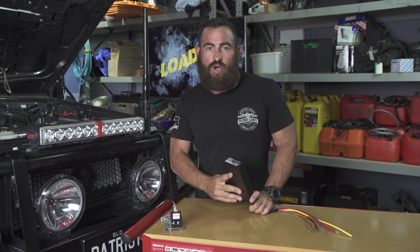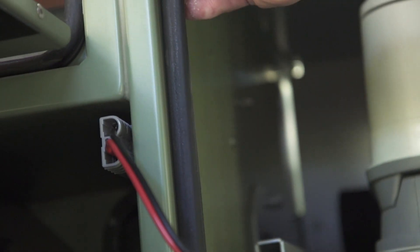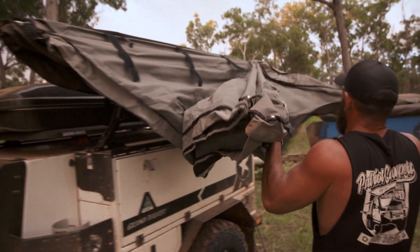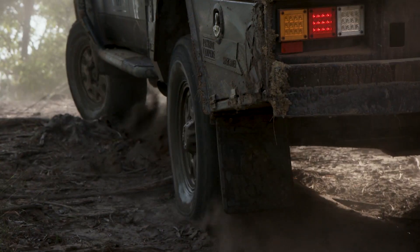When you're not driving, your alternator is not doing anything, so your auxiliary battery is not charging. With this unit, you can hook up your solar panels — the ones mounted on the roof — or put an external connection and lay out a solar blanket. While you're at camp drawing power from your auxiliary battery, you can put the power back in through solar, which is an absolutely awesome feature. Like all Redarc products, they are tried and tested in Australian conditions. You can see mine mounted right at the grille — through water crossings, cold temperatures in Colorado, and mud. They're fully sealed, Australian-made quality. Check them out — the Redarc BCDC 1225.